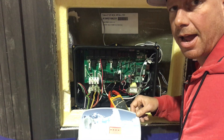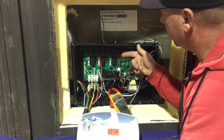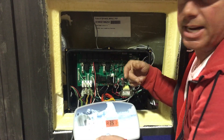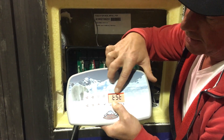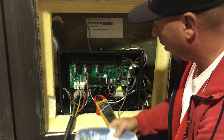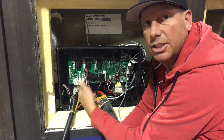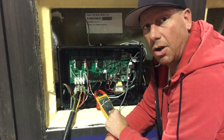I'm going to quickly explain testing the amperage going to the heater when you're on a TST. When you fire the tub up and turn the power on, it's going to go into TST mode, which sometimes you'll get an error of HPT. I've just reset the power, TST comes up, and we're going to have a five-second window when the heater relay is going to energize the heater with nothing flowing to test if the heater is actually heating the water.